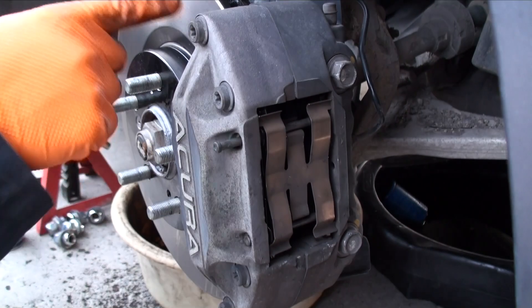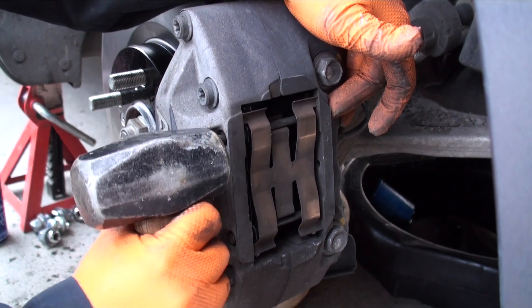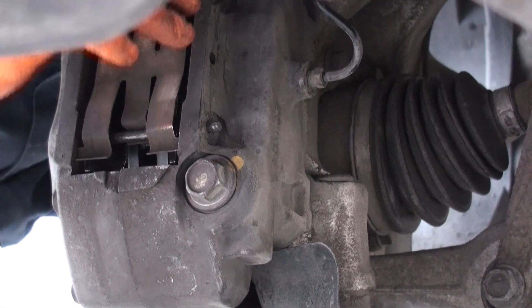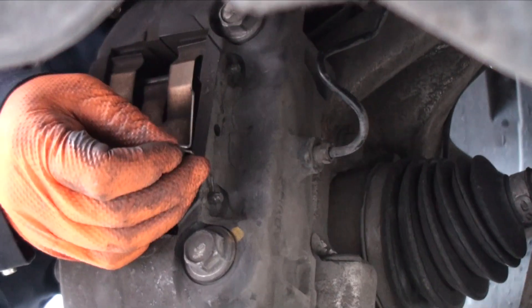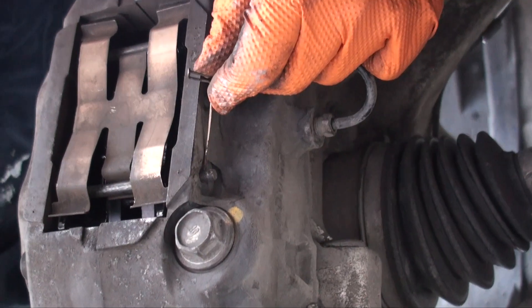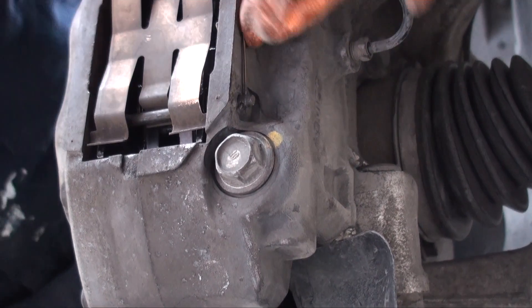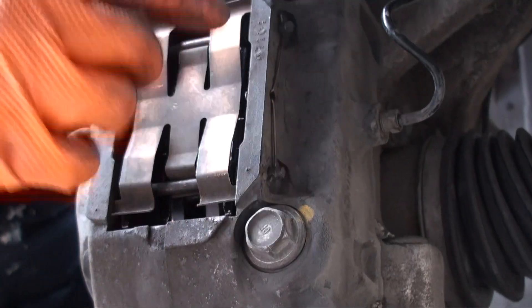With a little bit of finagling and manipulating of the rear pad, I got it to pass through the innermost pad. Using my hammer very carefully with the slightest amount of force, continue tapping this pin through until it passes through the other side. To install the spring clip, find the hole on the end of the pin, pass it through, and then bend the other side of this pin and line that up with the holes. Sometimes this is a bit of a tight fit and awkward — you have to rotate it a little bit to get it all lined up. Then once that's in, flex this spring clip a bit on the spring pin and place it into the caliper body. You should not be able to remove this spring clip with your fingers once it's been secured properly in the retaining pins and in the center borehole.